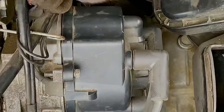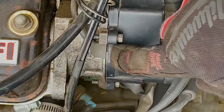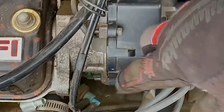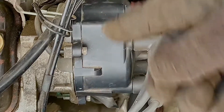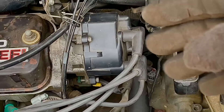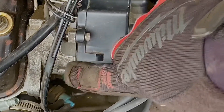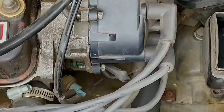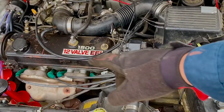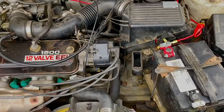You can see this crack here — there's supposed to be a gasket running all the way around between the plastic and the aluminum. But my distributor is so old that the gasket deteriorated and fell off slowly, so now nothing is sealing the inside. Moisture gets in, and when the spark starts going it creates that crust and stops the spark from reaching the spark plug. I have to take it off periodically to clean it, but eventually I'll need to fabricate or replace the gasket to stop the problem. Sometimes this also causes a loss of power because the spark isn't as strong.